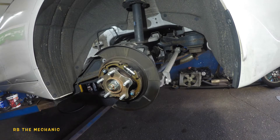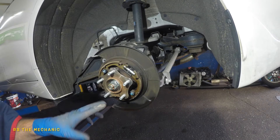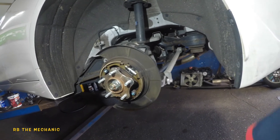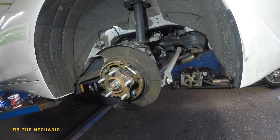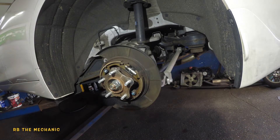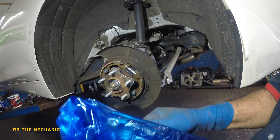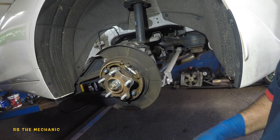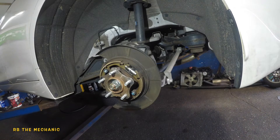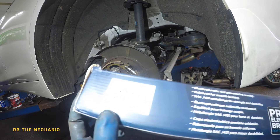Give it a moment to dry, then we'll put some grease on here and put the new disc on. When you get the new disc, make sure you clean it — watch more videos on how to do that because it has oil on the disc. We're using these e-coated brake rotors here, same style as what came out. It has oil all over it — see that — so I'm gonna clean it. The part number is on screen if you have the same vehicle.